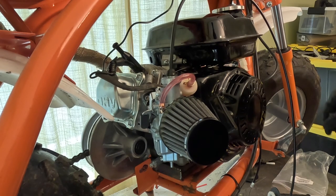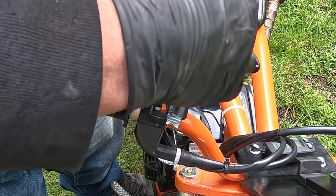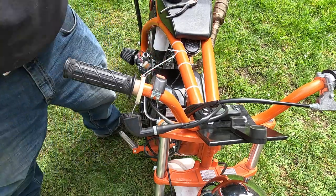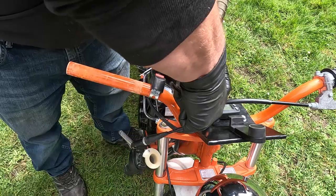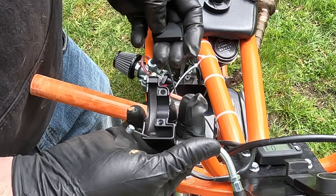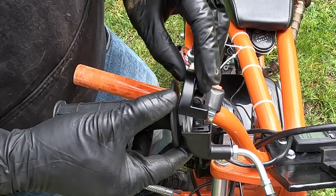Get the end of the cable seated — that makes it watertight. Now to run this cable up the handlebars, I'll take the old throttle off and get the new throttle on. I undo the screws holding the throttle onto the handlebars, cut the little cable ties — one of them is for the kill switch — and it slides right off. The little guide needs to go down in there, then the actual throttle itself goes in and sits in there, and then it all clamps together.